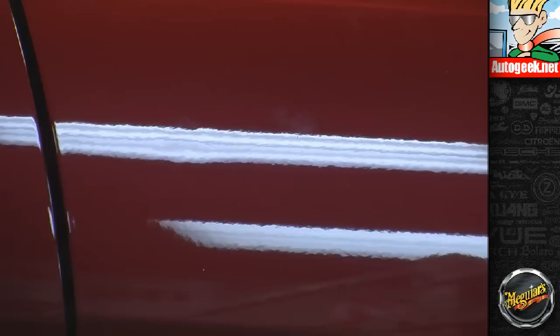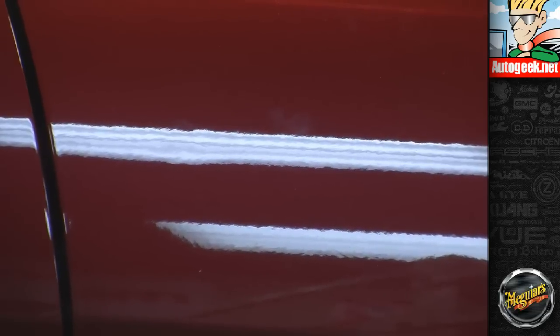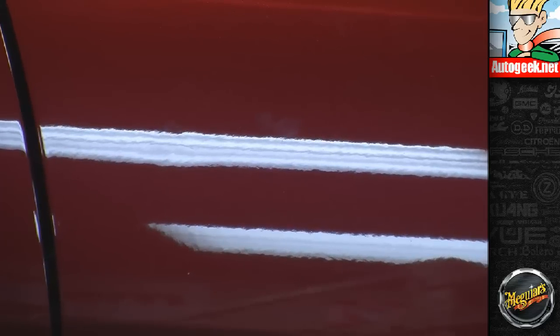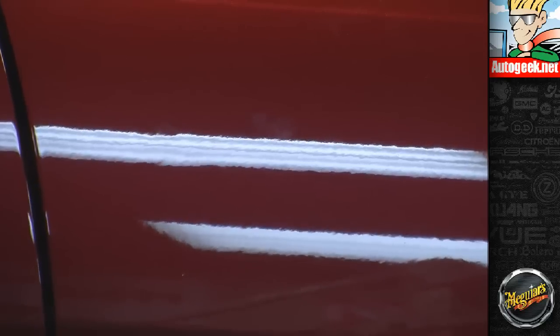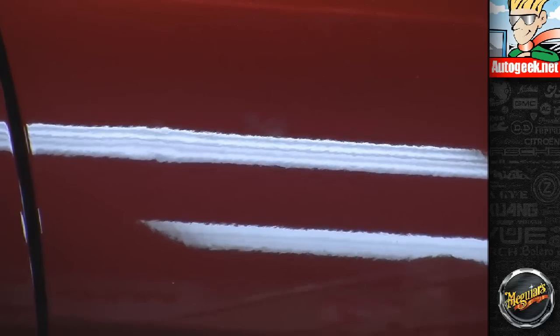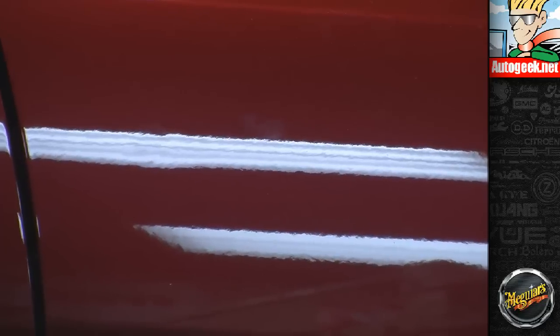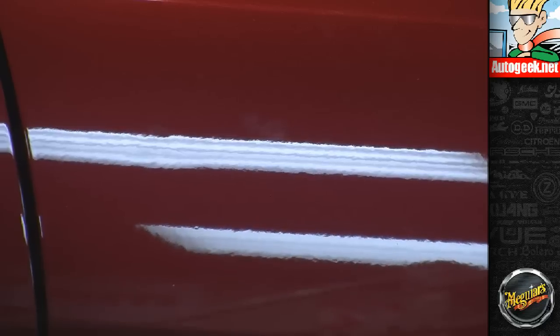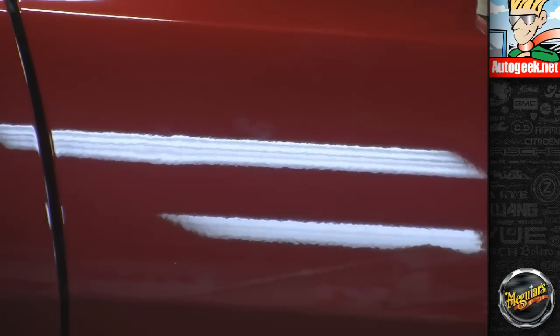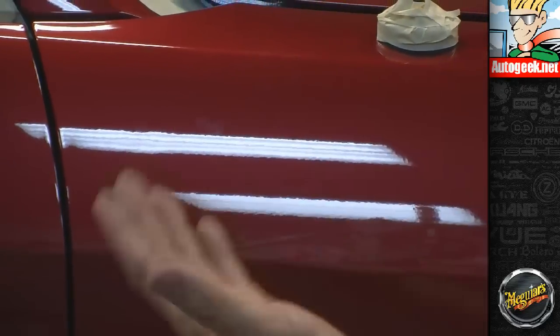It does. It's incredible. I can just barely see where that thing was. So that's about, I'm going to take a guess, about 30 pushes so far. Very small, exact pushes. And the stress from the panel, when I release pressure from the tool, is actually helping to pull the dent out and flatten the metal to its original stamped position from the factory. And notice I haven't done anything on the surface at this point. All my work is underneath the panel, so the original factory finish remains intact.